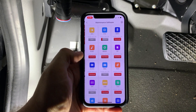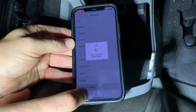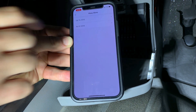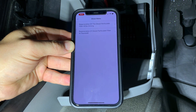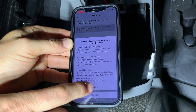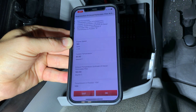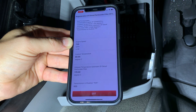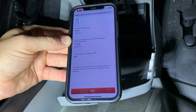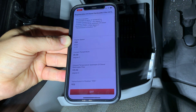Here we have the 2015 Mercedes Sprinter — a four-cylinder turbo diesel — and we're going to do the DPF regeneration on it; that's the diesel particulate filter. We're going to read exactly what's on the screen and follow all the instructions. You're going to have to know the make, the model, size, and other details that you might have to research for your vehicle before you can do some of these advanced tools. Make sure that you read everything on the screen and follow all the directions exactly, or you won't be able to complete some of the tasks successfully. Our temperature is not up to the 200 degrees or greater that it needs to be, so we don't have an okay, next, or advance button — all we can do is hit exit. We're going to need to get this vehicle up to temperature, so we might as well just take it for a drive.